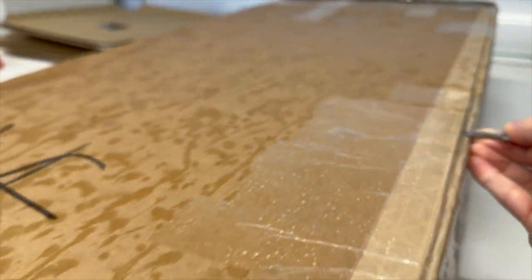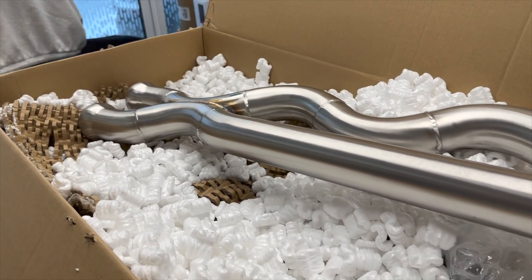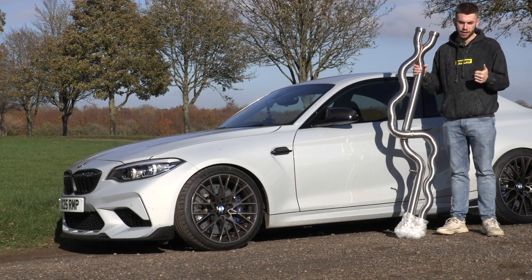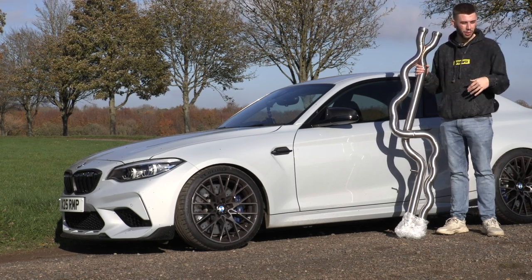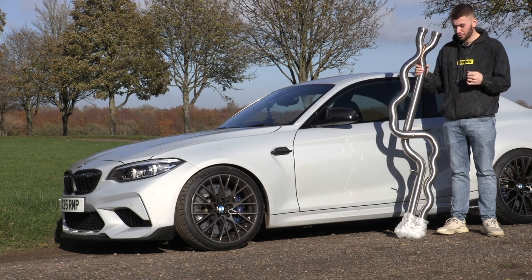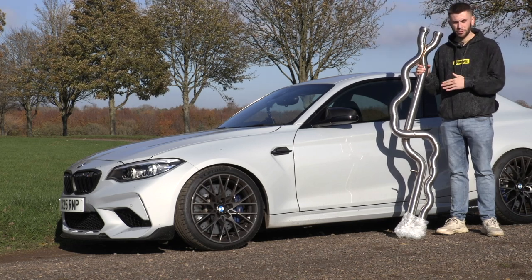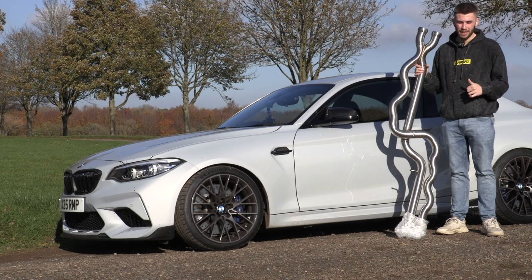It's like a wiggly worm, isn't it? The guys at Active Autowerks basically made this pipe to work with either the M Performance exhaust, the stock exhaust, or their own Active Autowerks cat-back system. They do have some disclaimers on their website, so you've got to be careful which exhaust you use with what. If you're going to have straight-pipe downpipes from another company or from Active Autowerks, they recommend you use the resonated version of this, because the whole point of this pipe was to eliminate that rasp. If you're running stock downpipes, it's safe to use the non-resonated. Or use the resonated version if you literally want no rasp at all. If you've got a stock pipe with a cat-back, get the non-res. If you've got an aftermarket system, consider the resonated version.